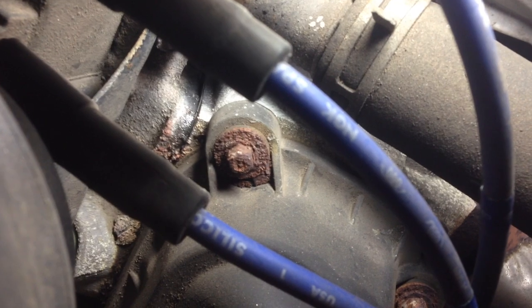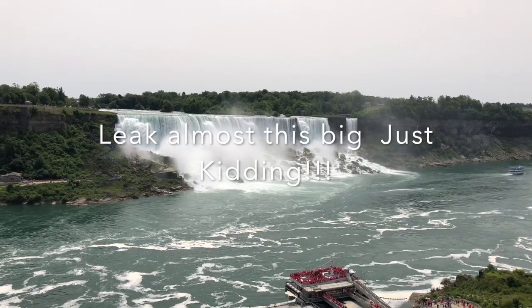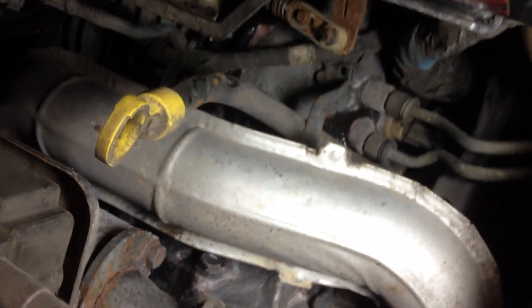We're back and I can hear it — hopefully you can hear it too. If we look here, we can actually see where the intake manifold meets the cylinder head — you can actually see that little bubbling right there. Let's get the video a little bit better. We can get in there a little tighter and you can see it actually bubbling there. I'm just gonna back up so you can see exactly where it is — it's right at the intake manifold where it meets the cylinder head.